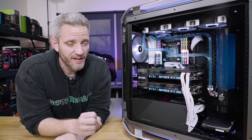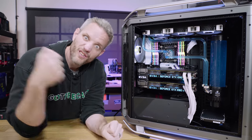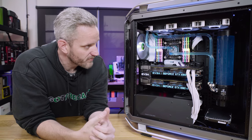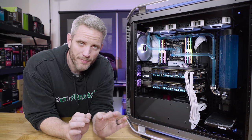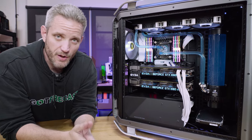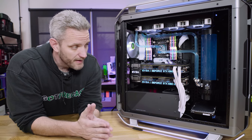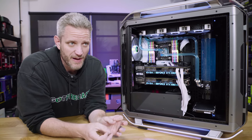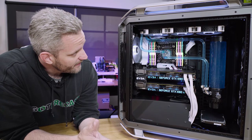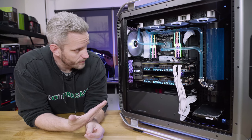This is not as perfectly clean as it should have been. The radiator — I was using my pressurized pump to force a lot of pressure through it, reversing direction so it wasn't just flowing one way. We got pretty much all the junk out, though there are still tiny bits that we noticed moving as we filled this up — they probably recollected in the radiator. I should have used an acidic cleaner for 24 hours and let it eat it all up, but this is my editing rig and I had to get it back up and running. Do as I say, not as I do — use proper cleaning methods, whether it be Blitz Pro cleaning or system prep stuff, whatever method you want. We're up and running. It seems like the bad luck I have with fluid continues, which is why I'm back to a clear fluid.